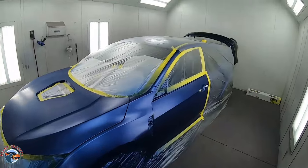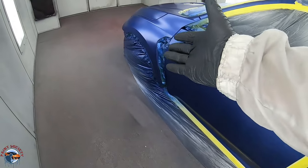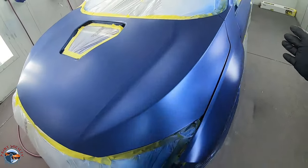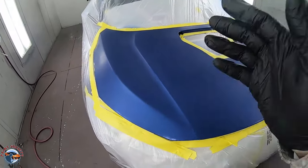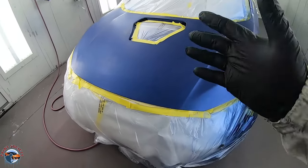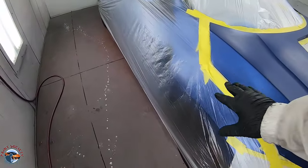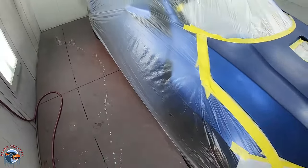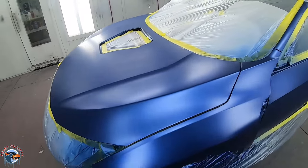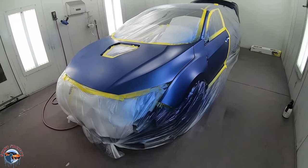Let me show you where I start and where I end. I'm going to start here at the bottom of the door and bring my paint all the way up to the front and across the hood. I'm not going to go crazy with that first coat - I'm just going to get it on. We'll bring our clear all the way over. Remember, this is just clear on clear, so any original damage that was on the vehicle will get cleared over - that is how it works when we're doing blends and insurance work. So if we were to fix any damage on this edge we'd have to paint the fender. I'm going to be using the Walcom 1.2 HTE clear gun. Let's get rolling.